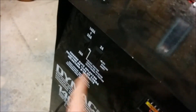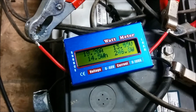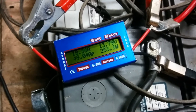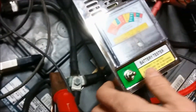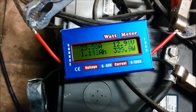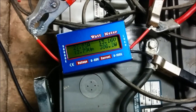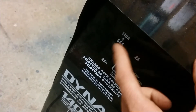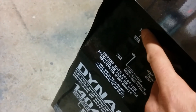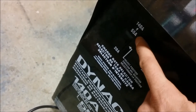It does in fact say 20 amps going in. It might be limiting, so I'm going to hit the load button. We're looking at around 25 amps — pretty dang good I think. Now the high setting, 55 to 140. That 140 is only if you're starting a car and it dips below 10 volts. It will normally be around 50 to 55 amps from what I've seen.